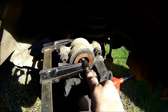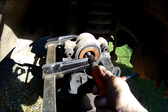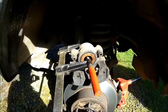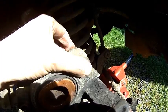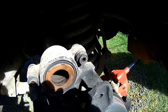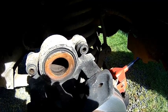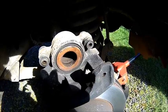Never reuse the brake fluid because brake fluid is hygroscopic and it accumulates water, so the boiling point goes down and then you've got other issues. Now we're full again — quite a bit of volume in this caliper. Let me finish that and then we reassemble it. So we're fully back now. Before we reassemble it, make sure these pins are actually moving smooth. Because otherwise you may have issues — the brakes can bind or they stick. It's a pain because if you go in the mud, the brake is not actually designed for that, but it happens. Anyway, let's put the pads in and reassemble it.